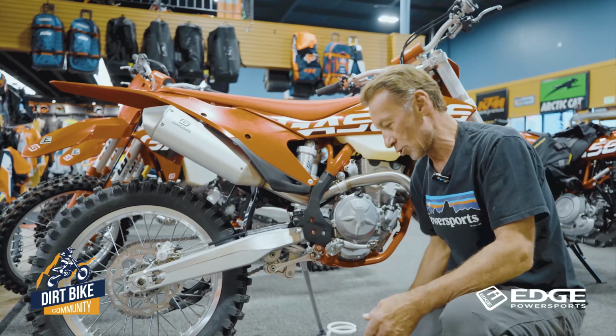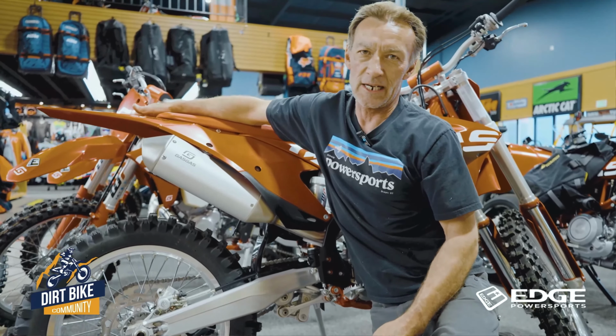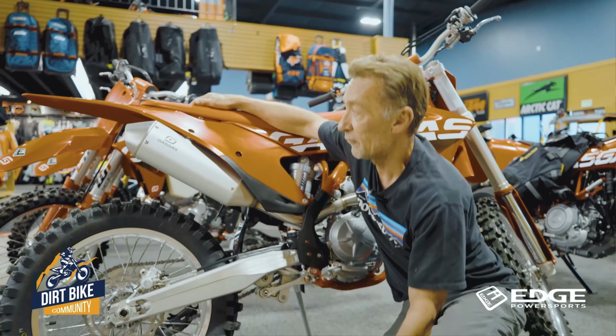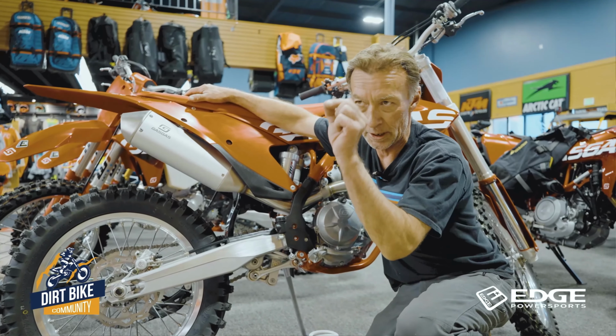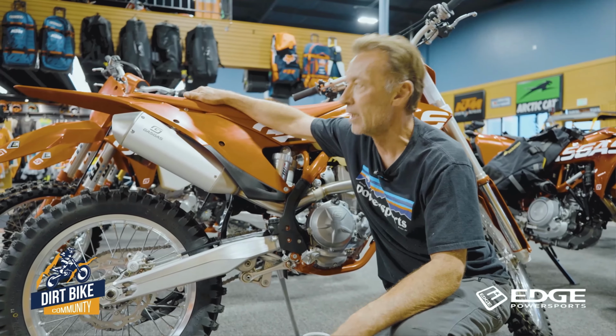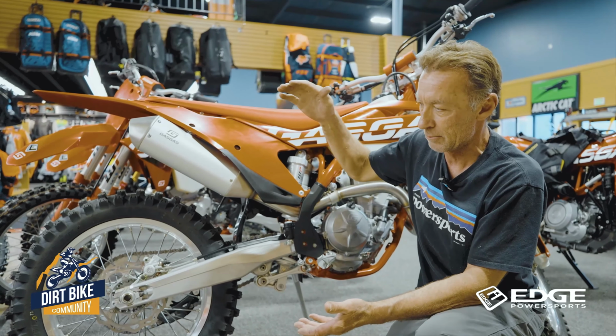And there's actually a little measuring tool we use. The nice thing about all these models of bike is there's a permanent sag mark on the opposite side of the fender that you can always measure from. If you don't have one of those measuring spots, put a piece of electrical tape on and cut a mark into it with a razor blade or something so that mark never moves on you. Ideally, you're going to get that measurement and set your sag appropriately.